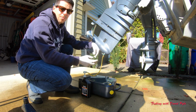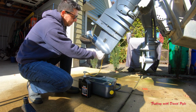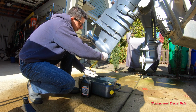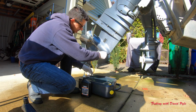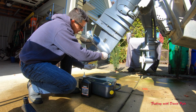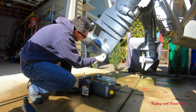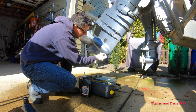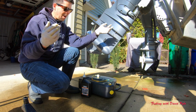It's not going to drain out really fast, but a little residual could drip out. So I'm going to try to either plug it with my finger, or get this out of the way real quick. Again, this is on nice hand tight, so easy to get off, but it is a little bit of a messy thing. You're going to get some gear lube on you. Okay, screwed out. As you can see, nothing really coming out of there is substantial, and it's kind of an odd angle, but it's pointing up and diagonal, and if you get it on first try, you won't lose much gear lube. I mean, probably a paper towel would help right now.